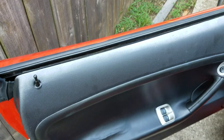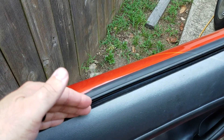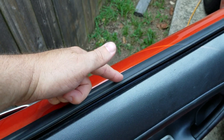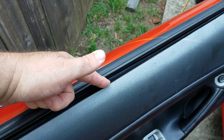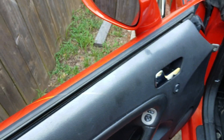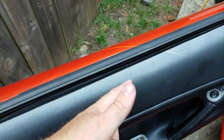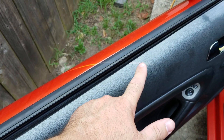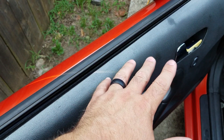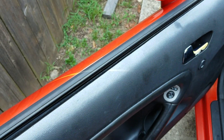Just expect that. Two quick notes before I get started: you need to be aware that you're gonna be putting out a lot of heat. You may want to put down something non-flammable to protect the weatherstrip and your finish over here. I'm not going to do that — I was fairly lucky on the other door, so I'm just gonna wing it. The other thing is: be sure not to touch the surface, as you're essentially going to be melting it to bring the color back out. Don't touch it — you're going to leave the imprint of your finger in it even when it's just barely warm, and you'll leave a little matted area that looks uneven. Keep your hands off of it. I didn't touch the other door for probably an hour after I got done with it.